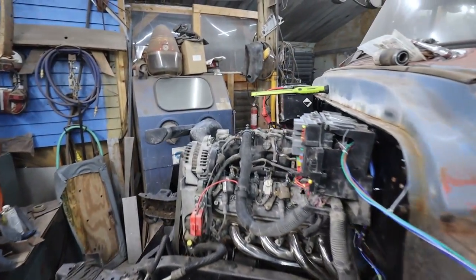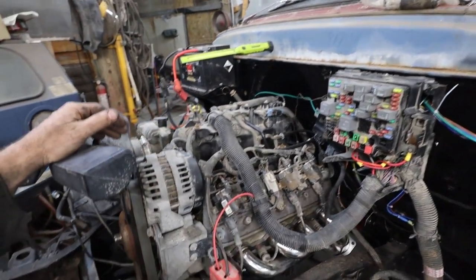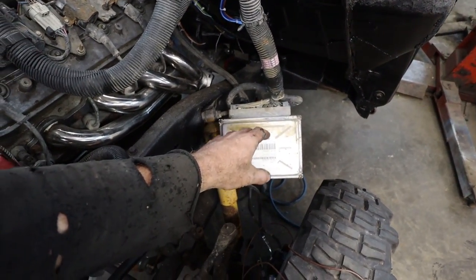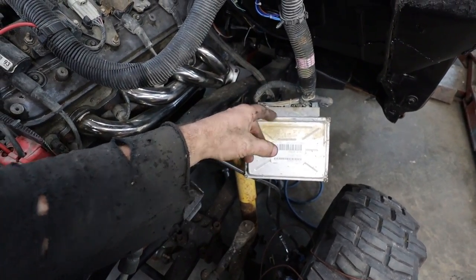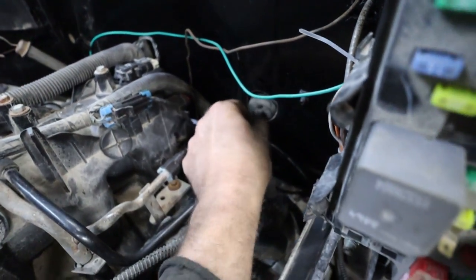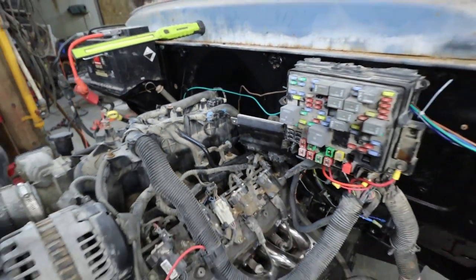Okay, so a few things have happened since. I kind of just stuck this on for the mass air. We just looped the tranny lines. I unlocked the computer. They had turned the rear O2s off, but they didn't turn the VATS off, so it's a good thing I took a look at that. We did punch a hole. This plug, not 100%, but anyways, we got the hole. Our gas pedal is in there. The module's right there for now.